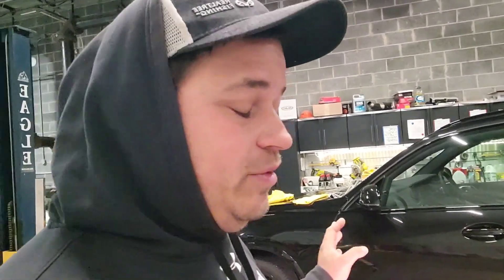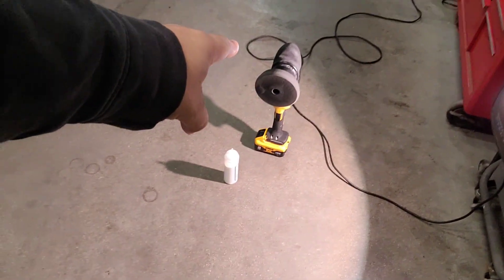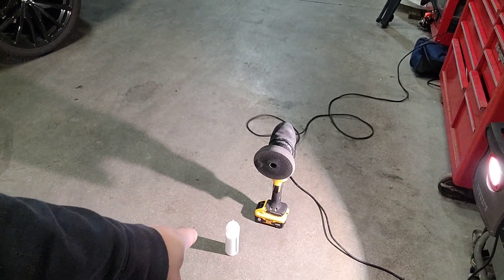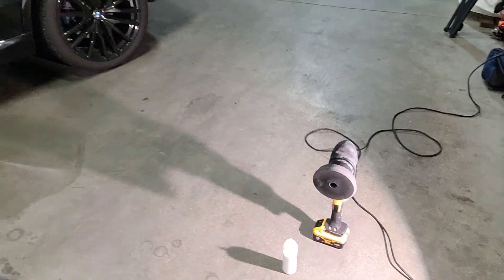It is making a difference in the clarity of the paint for sure. There's some water spotting on the hood — it's very light. I already took it off with WSP, which is an acid water spot remover, and then we'll be one-stepping over that. The one-step that I'm using is just a Lake Country Force Black pad with M210 on a cordless DeWalt DA.